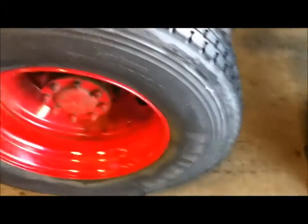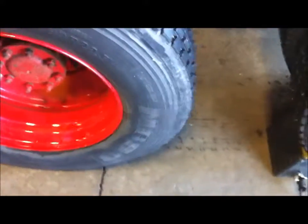After we do that, we're going to move to the rear axles. First, we're going to do tram, which I can explain to you right here. It is from rim to rim, and what I mean by that is we're going to go from the outside of the lip to the outside of the lip on both sides. This is going to ensure that your axles aren't further apart on one side, so one's not sitting like this and one's not sitting like this, and this will cause your vehicle to misalign and misdrive down the road, which would cause tire failure.